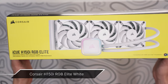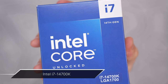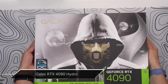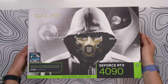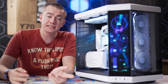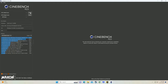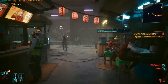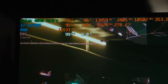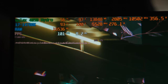That gave us the perfect ability to use the Corsair iCUE H150i RGB Elite white cooler with a 360mm radiator, cooling down our i7-14700K — the brand new 20-core CPU from Intel. We also had plenty of space to install the RTX 4090 from Galax, their Hydro White GPU, with its own 360mm radiator cooling it down — a combination that simply wouldn't be possible in the Y60. Here in the Y70 Touch, everything stays perfectly cool at max load, even while running a game and Cinebench simultaneously alongside Cyberpunk at max ray tracing, drawing over 850 watts. The CPU gets quite toasty as Intel 14th gen chips do, but the 4090 stays relatively cool thanks to fitting a 360mm radiator for both chips.